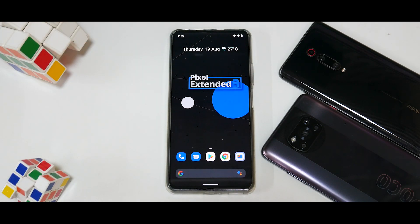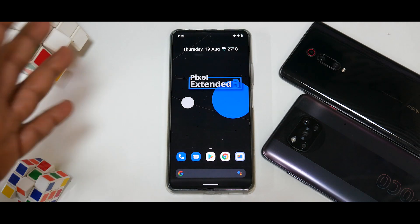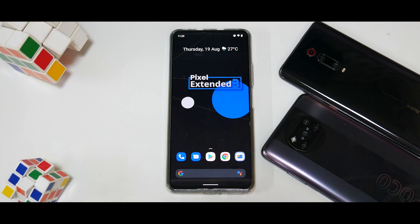Let's go ahead and install and then have a quick look — maybe I'll do a complete review or a gaming live stream later. Things to take care of: you need an unlocked bootloader, you need TWRP recovery installed — the recovery is linked in the description. Both files are linked in the description. If you want to install the Chinese version the process is exactly the same. Make sure you have more than 50% battery and back up everything on your phone's internal storage because things will be wiped. Remove the lock screen password, Google account, Mi account, face unlock, fingerprint unlock — all security-related features.